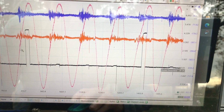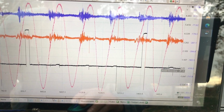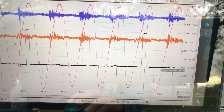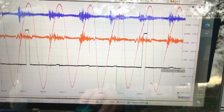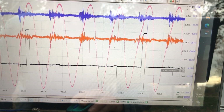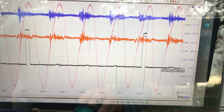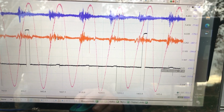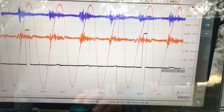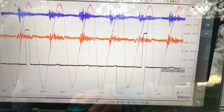Basically same situation again. We got our vacuum pulls denoting what cylinder is on its intake stroke. We can deduce a lot from the 720 degrees between here and here. You set up the rulers, you set up your overlay. Obviously, we're looking closely at our microphones, and we're going to deem this good. This car does not have any noises that are abnormal, like a broken valve spring, a valve issue, anything valve train related. So just something to bear in mind.